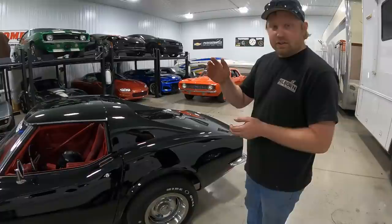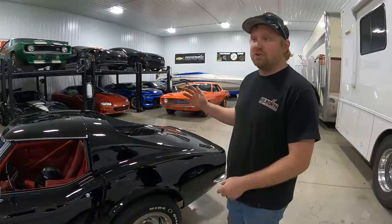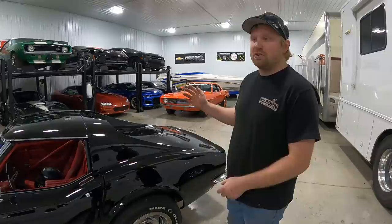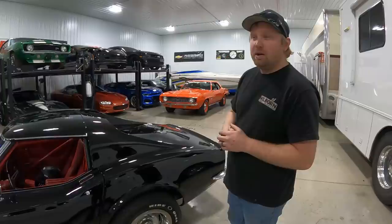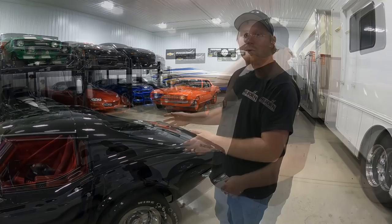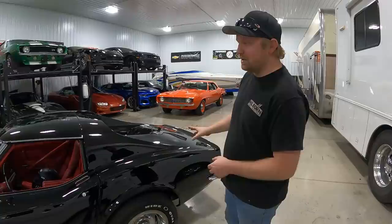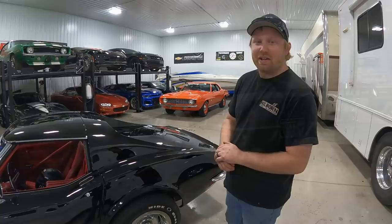The car still has the factory IRS rear suspension with a factory single leaf spring and factory trailing arms. The only upgrades are a 12-bolt rear differential, and the output shafts were upgraded — we tried aluminum half shafts but broke two of them this year, so we're going back to chrome-moly. Other than that the rear suspension is 100% stock. It's got a 4.10 rear gear, a spool, and QA1 adjustable rear shocks — as old as the front shocks, but working well enough that we're leaving them alone.